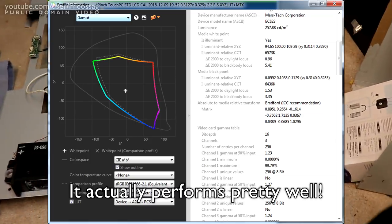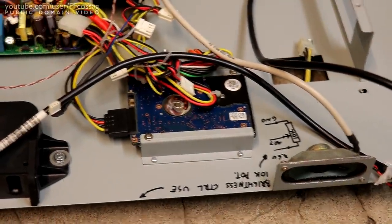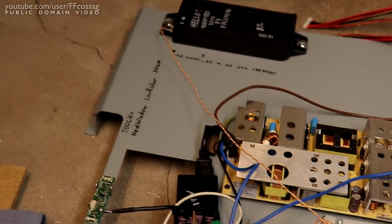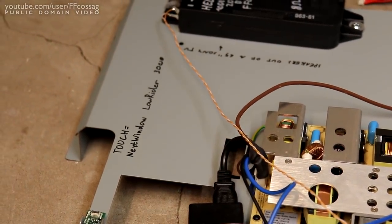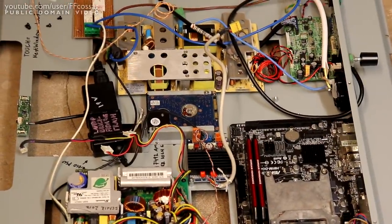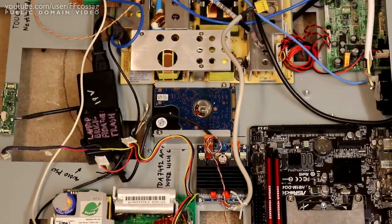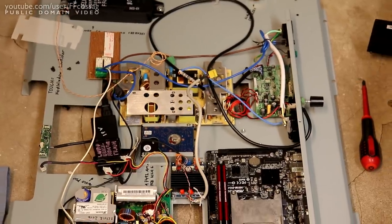What we're going to do now is first remove the hard drive cage, because that's the biggest obstacle. I'll probably just put it somewhere out of the way. Here's the mock-up — I've removed the hard drive cage and placed that right in the middle. Two other mounting holes for the bracket are going to go kind of underneath the TV power supply, but that's just fine — it's not touching anything. It fits really tightly and neatly in there, which is a relief, because fitting it anywhere else would require an unreasonably long SATA cable.